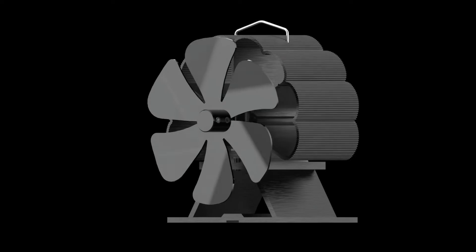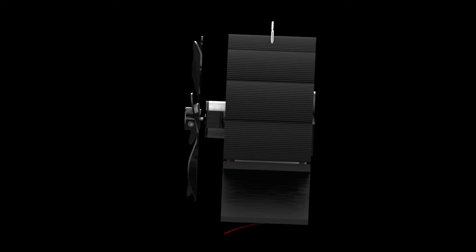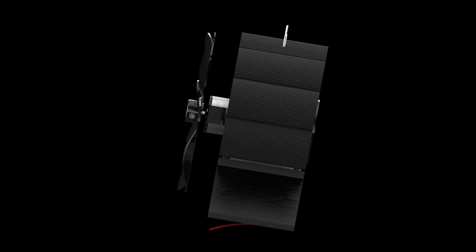When the bimetallic strip on the base is overheated, it bends to lift the fan and protect the low quality components. This results in the energy being throttled and reduces efficiency. Lifting makes the fan unstable and can also cause vibration and excess noise.